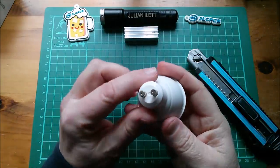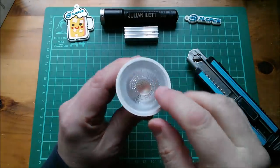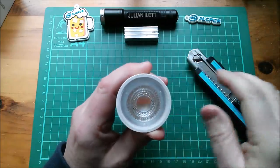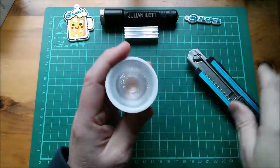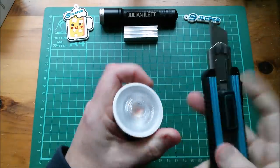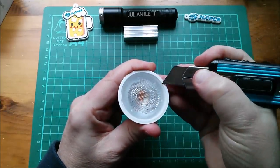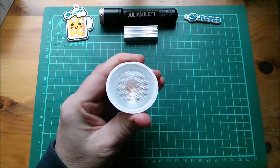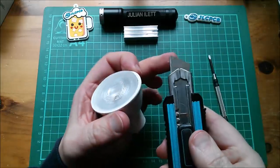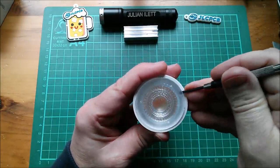I can't see any way into this other than through the front. There's a glued-in front plastic face — you can see the glue residue. It's lovely and warm, actually really nice. I'll try and dig this out with a knife off camera — this could go horribly wrong. The inevitable happened: the tip of the knife broke off, but I've managed to get a screwdriver in and get the front off.